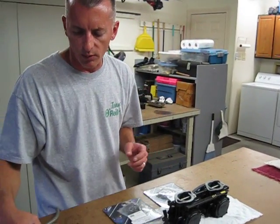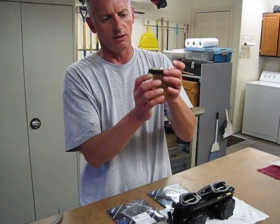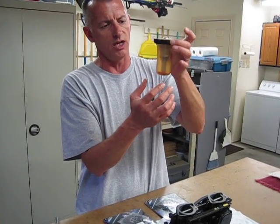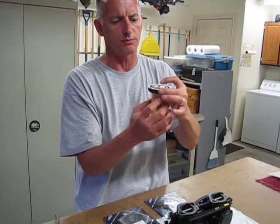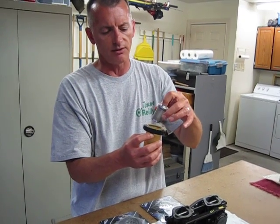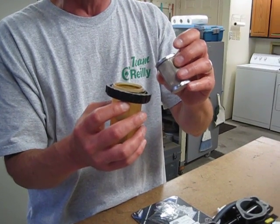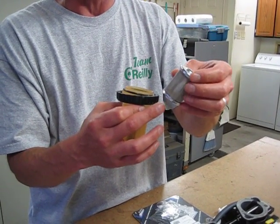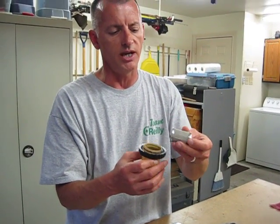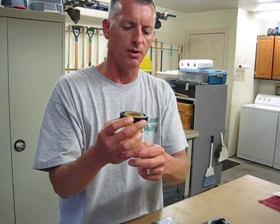We also noticed, when we were back at the boat ramp, there was this device, and it hangs right underneath the steering column of the jet ski, and it was filled with gas, and there were gas lines going to it and all these other things, and at first blush it looked like, well, that's probably the fuel filter, although we didn't know that for sure. We found out later that this is actually a water trap, and it's got this piece inside of it. If you look down inside, there's some snotty looking stuff that's accumulated over the years. It's probably never been cleaned, and we're probably going to have to deal with that, either replace it or, if we can't clean it, replace it. But this is actually what this is. It's not a fuel filter per se, but it is a water trap.